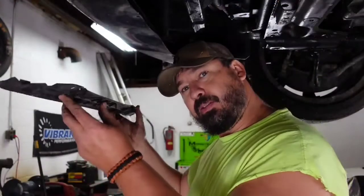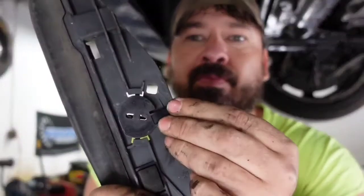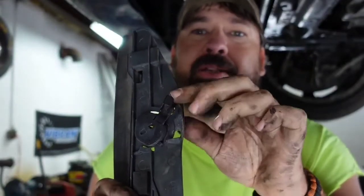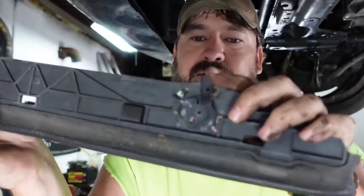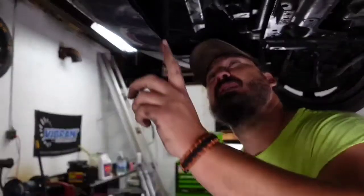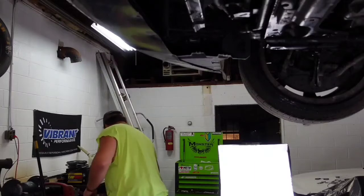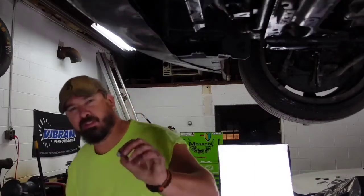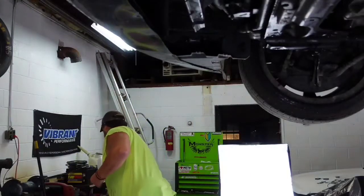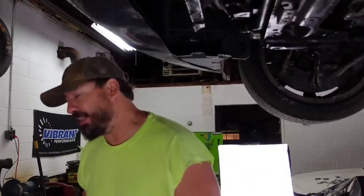All right, so on the bottom of the intercooler, there was these two little spinning top tabs you can see here. Actually, they're locked in like here. And so I had to pop it out and spin both of them. I did that on both sides of this. And then there was the spin ones that were on here that I showed you, and then there was one on each side of just the little screws, both sides. There was one on each side. I think it's, let's see what size it is. I used a T20, but I think it's actually a T25, but the 20 worked.